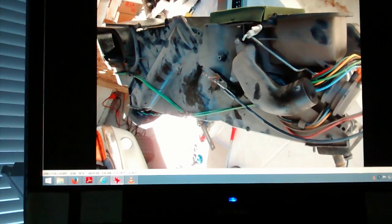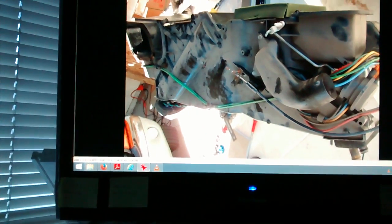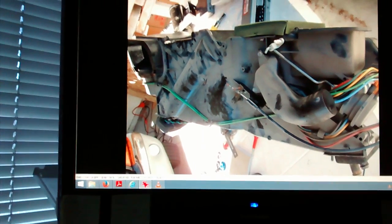When I did that, I broke it, and I was able to just take a drill bit and drill. I couldn't pull it out of the little connector, so I just took a drill bit just a little bit smaller than the diameter of the tube, and I just hand drilled it, and it popped right out. I only lost about maybe that much of the hose, and that didn't end up being a problem. You can just push the old one back through the hole.